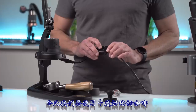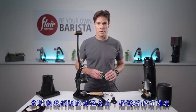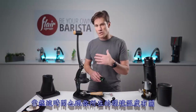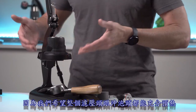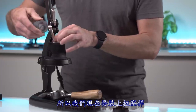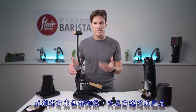Today we're going to be brewing with a medium roast, so press and hold for two seconds to turn it on to low, then press quickly for the second light — it will continue to blink until we reach temperature. This usually takes about three minutes, but depends on ambient temperature. We recommend letting it heat for about 10 minutes so the entire brew head and brew group heats up, not just the cylinder. Go ahead and put on the stem and lock in the portafilter.